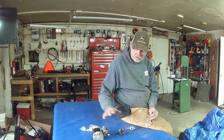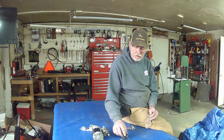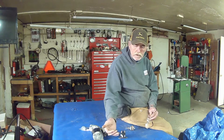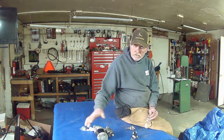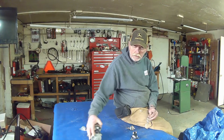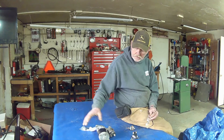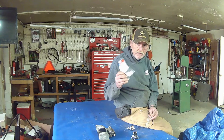So to recap: this standalone solenoid mounts on the frame — three-wire grounds itself to the frame, four-wire has a dedicated ground wire. The other style mounts on top of your starter with a wire from your battery and a wire from your key switch that energizes the solenoid to start it. If you're having issues, check your safety switches.